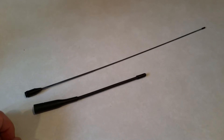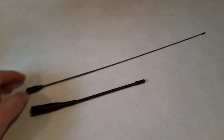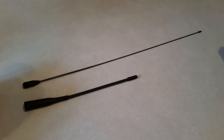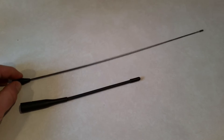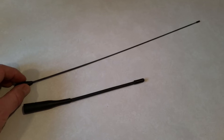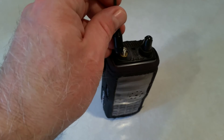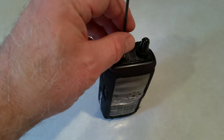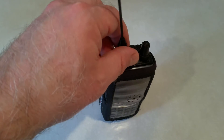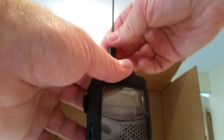The new antenna should just screw right onto there and get me a little bit more gain. It's pretty much twice the length of the existing antenna, and those who know about antennas would say you're probably going to get some improvement. Gain is a funny thing because it's decibels over an isotropic emitter — a relative number. I spin it backwards a short part of the turn just to make sure the threads are lined up before tightening it down.